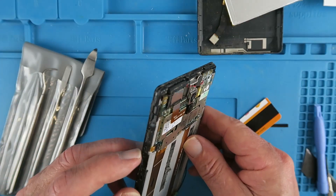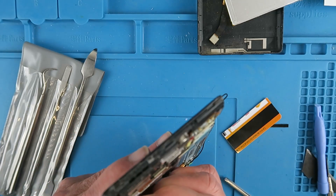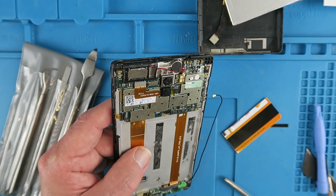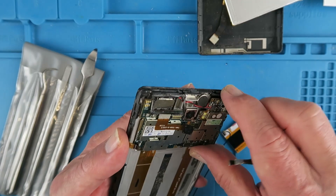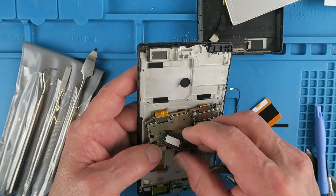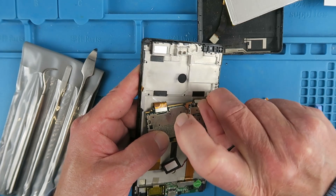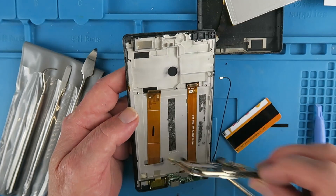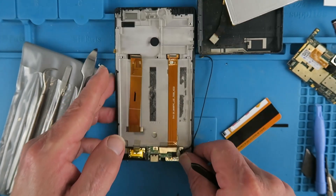I can see there's a small ribbon cable here which must be for switches or something. That little tab just lifts up. This again feels like it's stuck down. Once we have those removed, we can then get to the attachments for the screen and the digitizer. Again, that is loose, so somebody has been in here before.